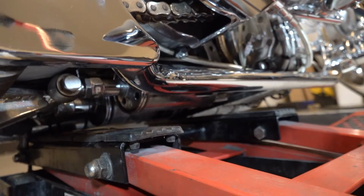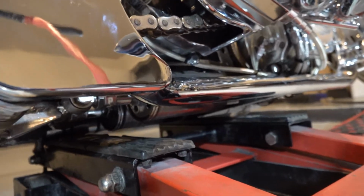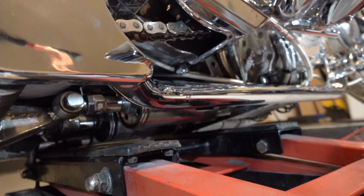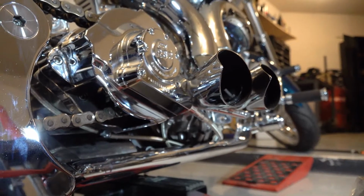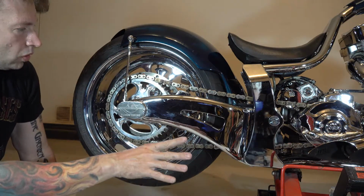When you slide the jack stand under the bike, you want to make sure that you're not going to damage something. So look for any kind of lines or wires. Make sure it looks good around the shocks. Ideally straddle the shocks, and make sure it's back far enough that it'll lift the rear end and not the front end.